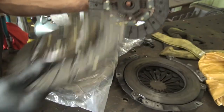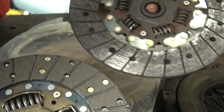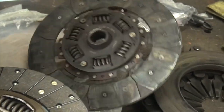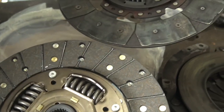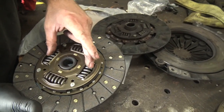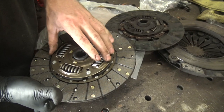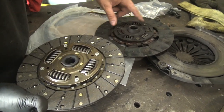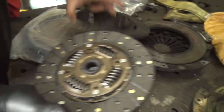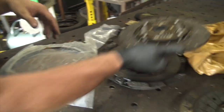That's the difference between the two — wow. That's what it's supposed to look like on both sides. This side doesn't look that bad; generally one side will wear down and the other will be just fine. You can see there's a little bit of a difference here — these are small springs on this one, this one has larger springs. These are just vibration-dampening springs. This little plate in here is actually two separate pieces, so when you engage the clutch it gives a little cushion effect. That doesn't mean six springs is better than four springs — these are actually double-sprung with little springs inside the middle. Probably just two cents cheaper for the manufacturer — who knows why they do what they do.